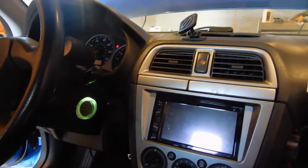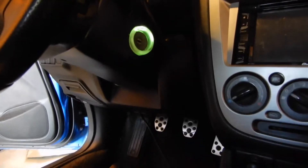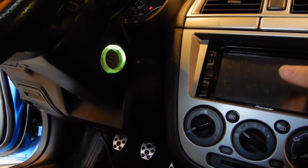So just a little update on how this Accessport is going — not good. This is just for the 2003; I'm not sure how the other years are, if they're the same or not. But it's supposed to be — there's a little place you plug in one connector, and there's supposed to be two green test connectors you plug in to make it so it can reflash your ECU. I go under there and they're already plugged in, so that means it's been in test mode this whole time, I'm assuming, because they're plugged in.